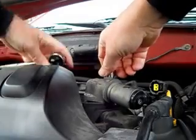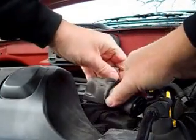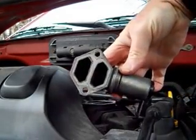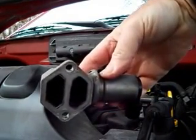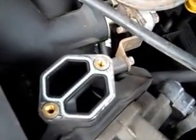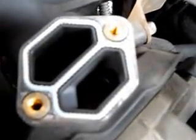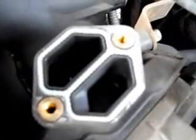This car has 71,000 miles on it and it's been doing this off and on. It started in July and then it went away — I thought it was a vacuum leak, different things like that. Well, there's the inside of the valve. You can see it's covered in black soot. I don't know if I have anything abrasive or caustic enough to clean that, but I'm going to give it a shot. The gasket still seems to be in good shape — that's the white you see there. I'll probably spray some stuff down in there too — I have Gum-Out, throttle cleaner. I'm going to go in the garage, get a coffee can and start spraying.